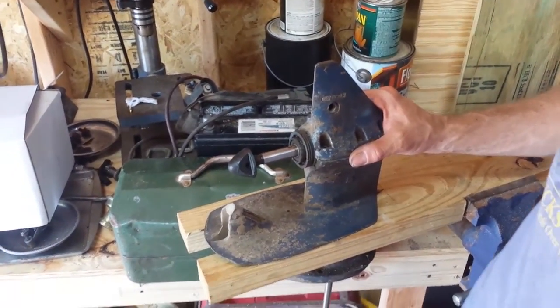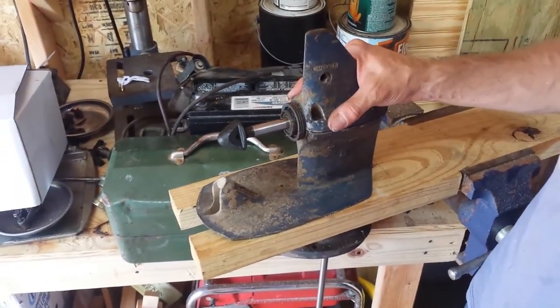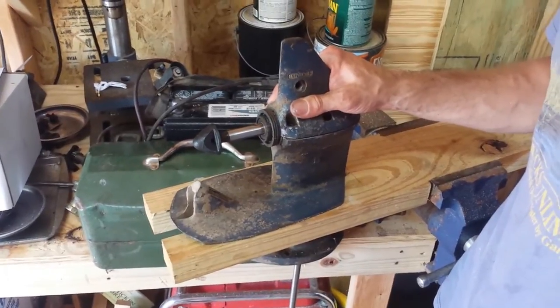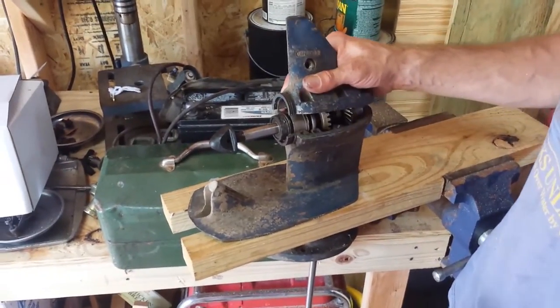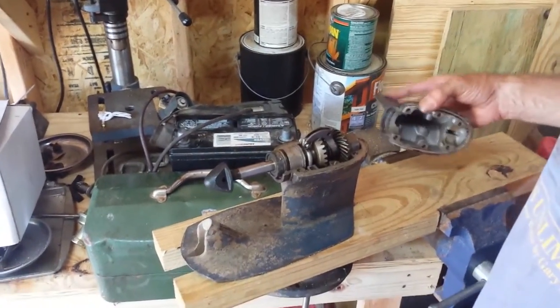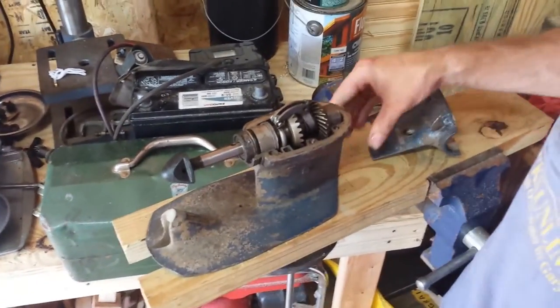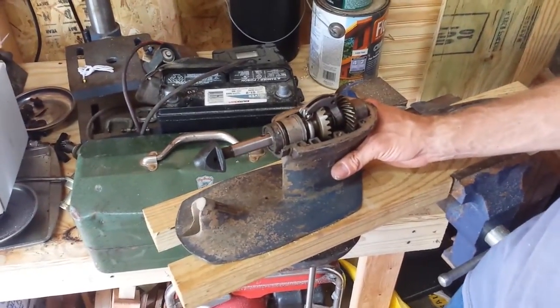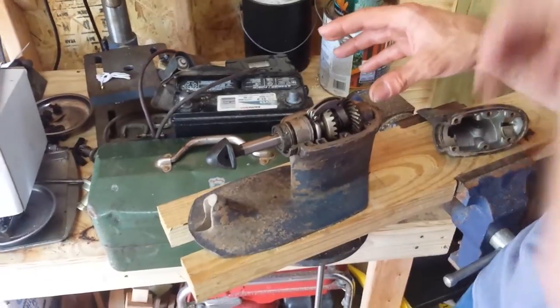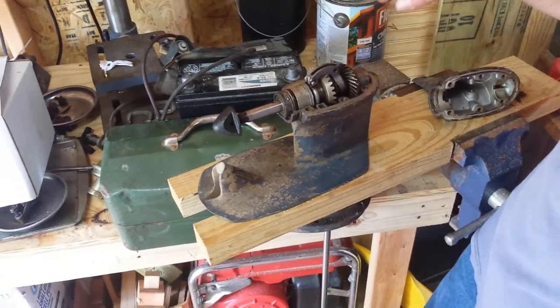Hi, this is James from Highland Outboards. I've been getting a lot of questions recently about gear case mechanisms, which translate the rotation of the drive shaft into either forward or reverse rotation of the prop shaft. Today I'm going to dissect a gear case housing and show you exactly how that works. This is a lower unit from a Johnson, Evinrude, or OMC classic outboard — a six horsepower model. Most other models are similar in the pieces that make it work, but not always identical.